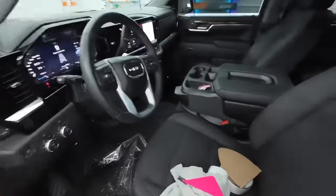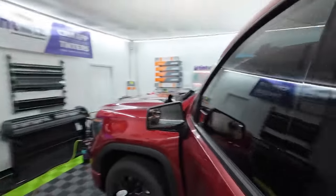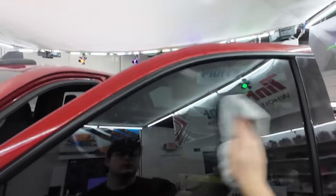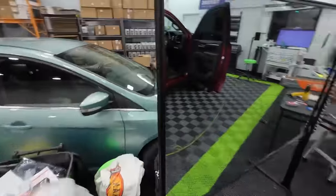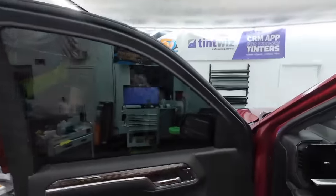Swipe all the way across and make sure you get all that water out. A little extra pressure along the stamping helps clear all that air out. Then grab your towel, wipe off the window, and check over your work — if you did everything right, everything should be good. Free to move on to the next door window. Beautiful — that looks great. I didn't have to use seal tape on the sides. A big part of keeping a window clean is just your installation process; the more direct you are, the cleaner everything's going to be.